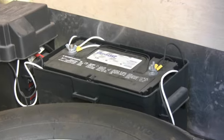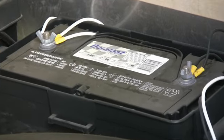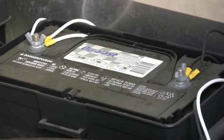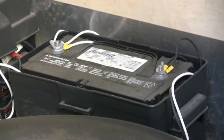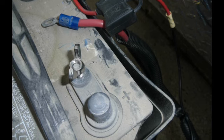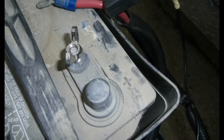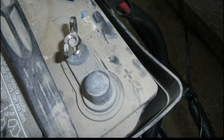The TSC requires a full-size 12 volt DC trailer battery for best performance — typically a 12 volt DC marine RV deep cycle battery. Do not use a small gel cell battery or the small battery of your trailer's breakaway switch to power the TSC. Before performing any work on your trailer's wiring, be sure to disconnect all wires going to the positive terminal of the trailer battery. Also, unplug the trailer connector from the truck as well as shore power.